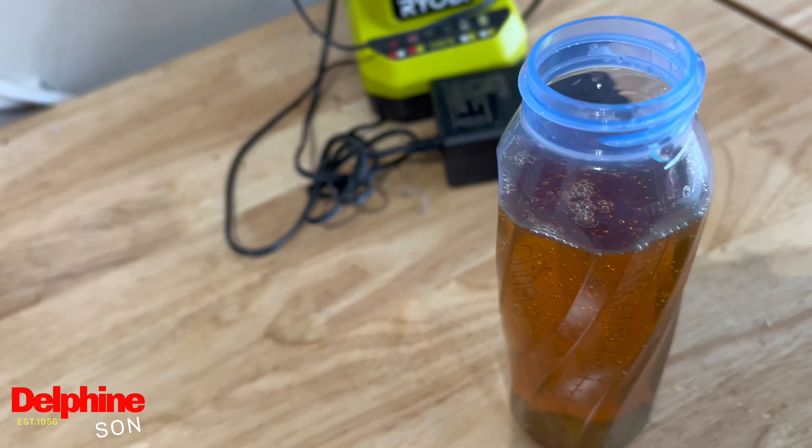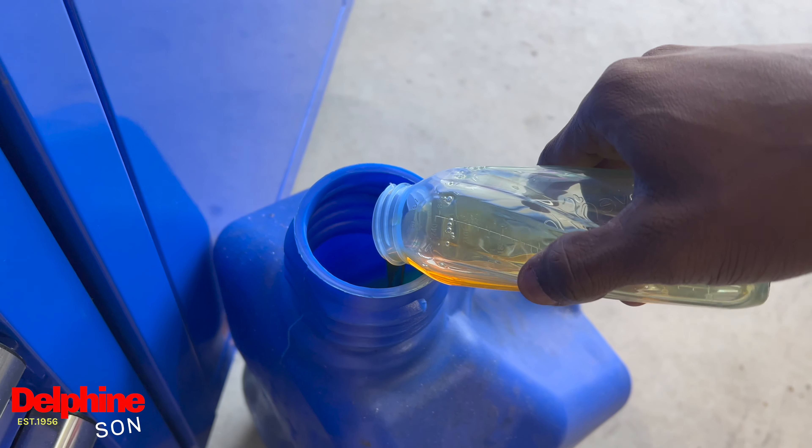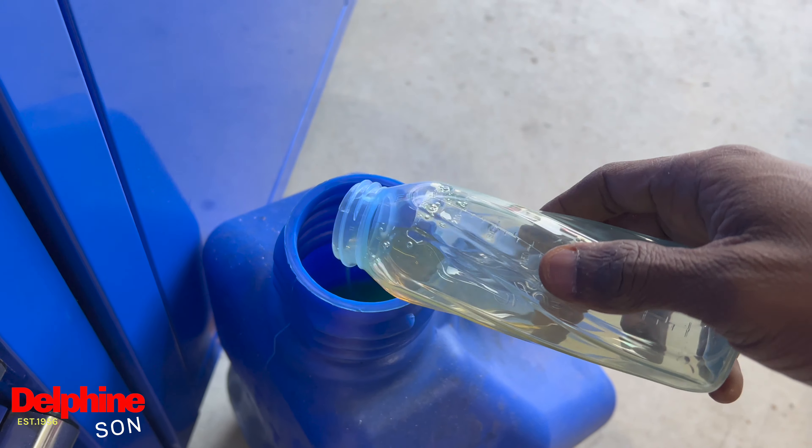Two gallons of gas, you're supposed to put four ounces to each gallon. I don't know where my baby bottle is at. So I got two gallons so that means eight ounces of oil. I normally have a bottle in here — I might have to steal one of my grandbaby's bottles. We got that eight ounces pulled up, drop it on in just like that. We're gonna shake it up and pour a little gas back in to get all that oil out so we got the full eight ounces, then we'll put it in the bikes.